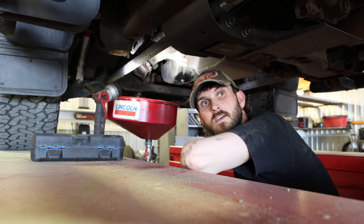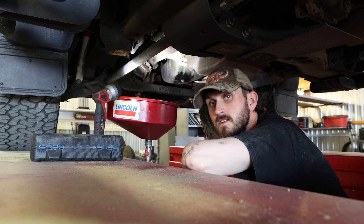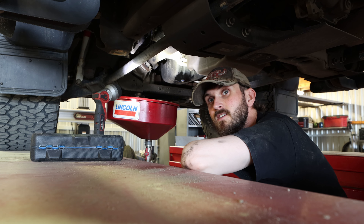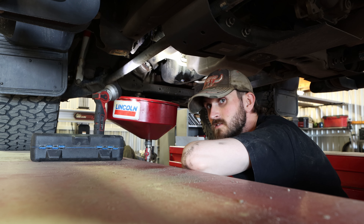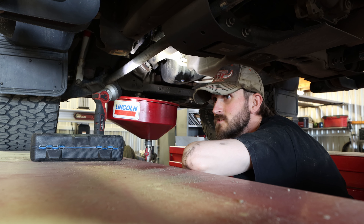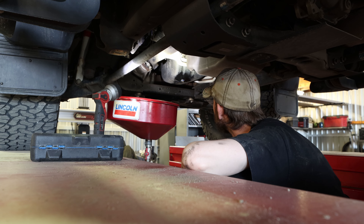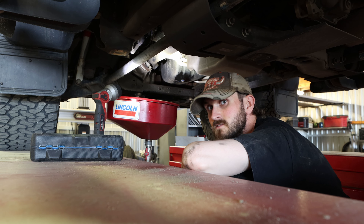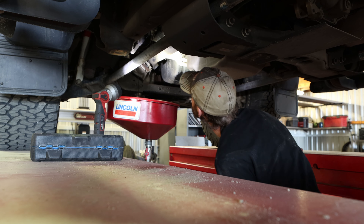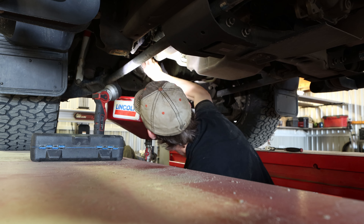Everything looks great and the airbags are working, but there's a small problem — there's an axle seal. I smelt gear oil this morning when I was driving it and I thought, this is weird. Yeah — front axle seal. It is kind of a GM thing to have front axle seals go. They're super easy to fix, but nonetheless it's a thing. So Kyle, get that looked after. Not even any oil on my hands — though there is oil all over this.